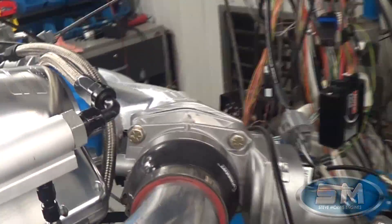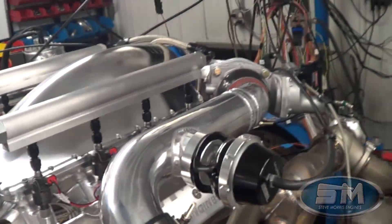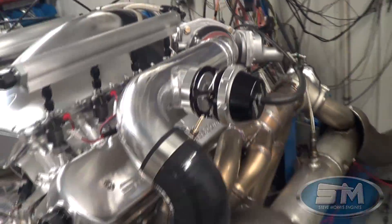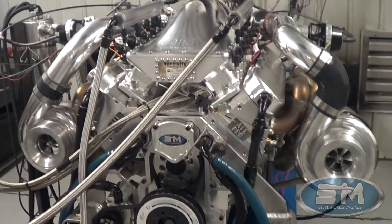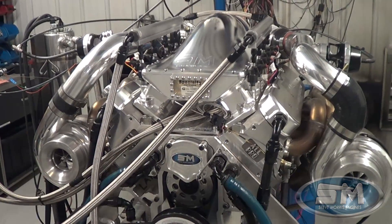Something you'll see that we have on here is twin drive-by-wire throttle bodies on our billet Ramshorn elbow. Something different for us too is this is MoTeC — the M150 ECU with the E888 exhaust gas temperature module and dual lambda wideband sensors. Normal stuff there.